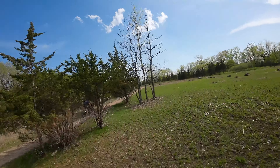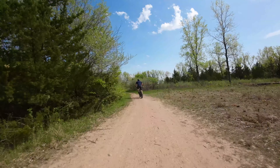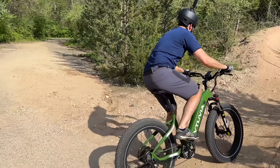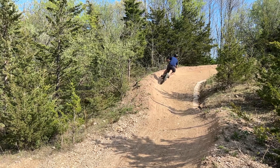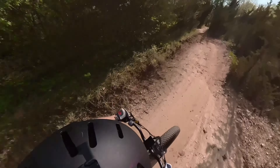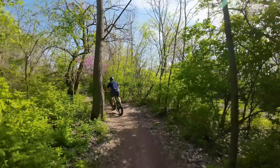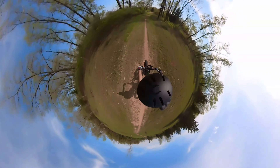Overall, I would say the front shocks are not quite as good as the higher-end shocks on my mountain bike, and I'm definitely missing having that rear suspension. You can lower the tire pressure as low as 5 or 10 PSI on these fat tire bikes, but I definitely don't recommend it if you are going 30 miles an hour — the steering on basically flat tires is not so hot, you feel like the wheel's rolling around. So I kept the pressure pretty high, and with that it's definitely not as squishy a ride as I'm used to. One other thing I'm going to change on this bike is the grips. They have a big high-surface-area palm rest, but the material is a kind of fake leather — I definitely need some rubber to help me maintain a good grip on the handlebars.